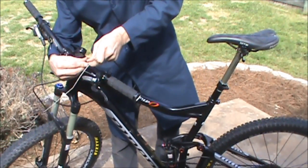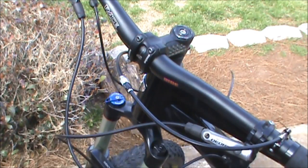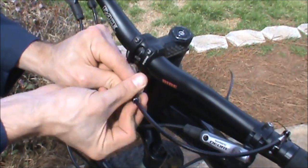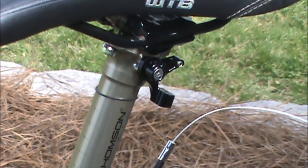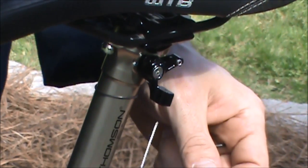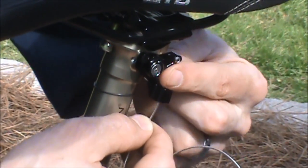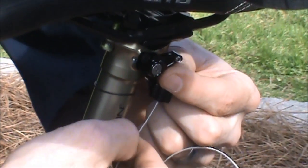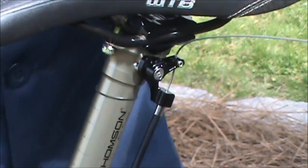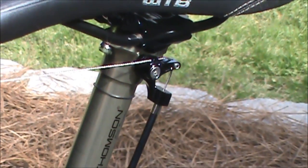You're now ready for the final routing of your cable. Before cutting your cable, take the adjustment out of the micro adjuster. Complete the routing of your cable: slide the housing and cable through the plastic cable guide and through the cable housing stop, then slide through the small hole in the cam lever itself. Secure with a 1.5mm Allen key.